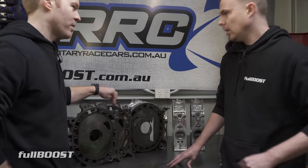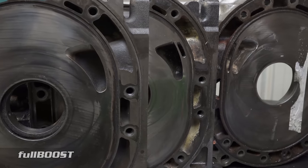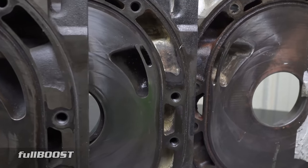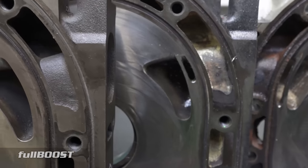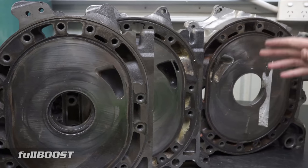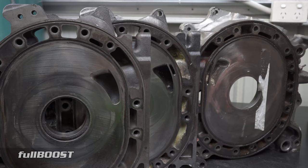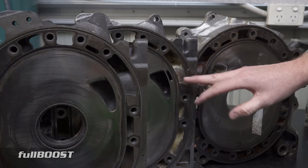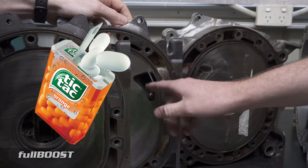This style is also a bridge port — there are many different names. Originally, going back close to 20 odd years ago, turbo engines were never bridge ported. The common myth was that due to the overlap, you can't turbo a bridge port engine — your boost is just being evacuated because the big overlap is going to blow out the intake ports. When a few guys started building turbo bridge ports it was pretty mind-blowing. They were called secondary bridge ports, turbo bridge ports, or even tic-tac ports — because it's just a little tic-tac shaped port that's complementing the normal extend port.